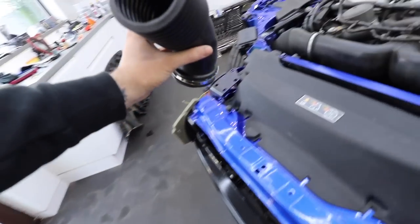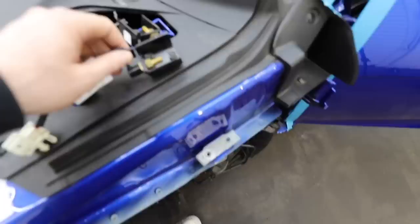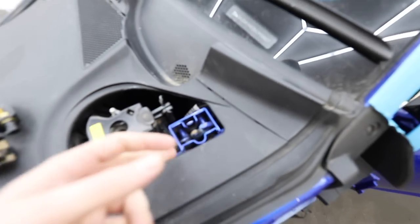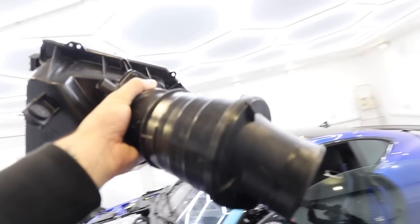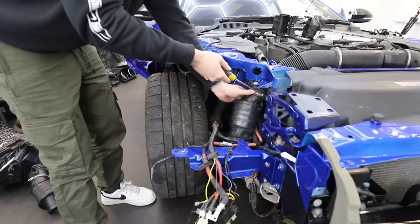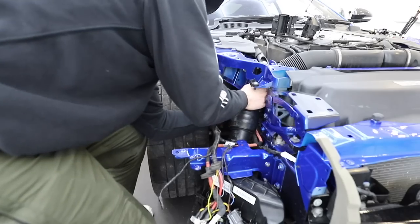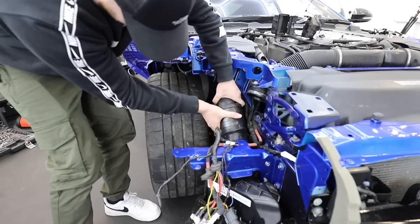Dan has given us more parts than just the dashboard. We've got a new steering wheel airbag, some new sensors, two new wheel arch liners, a plastic section for up front, and also a new airbox — which is very handy. It does mean I didn't need to buy the MAF sensor separately, which was a bit of a waste of money, but it works out right in the end. I can now remove this bit of intake pipe which had a very small amount of damage, and fit the new perfect one instead. I ended up splitting it into two parts — the MAF and the top section of pipe — fitting that and then fitting the airbox to the rubber grommets which mount it to the car.